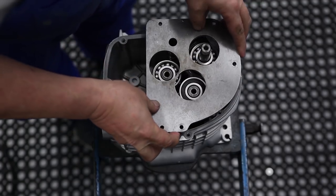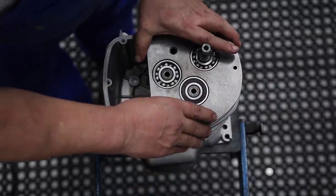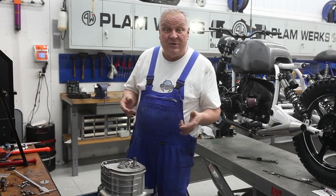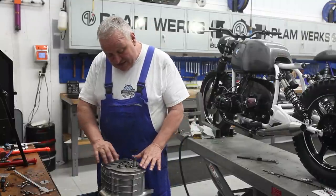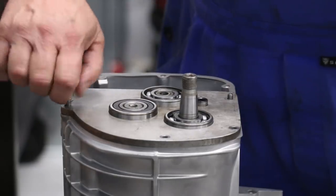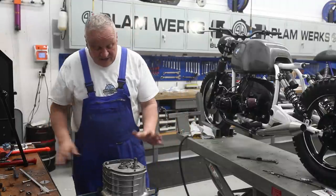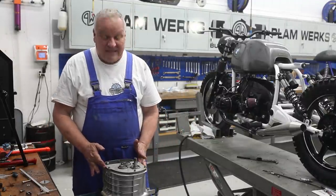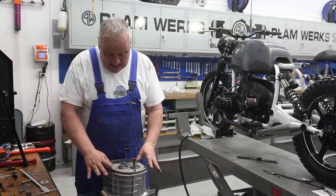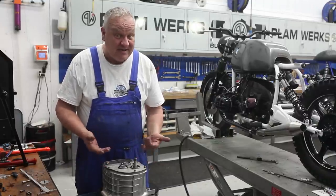And it fits on there. Now, I like to, some people don't, measure with the gasket. There's different ways you can do it with or without the gasket. The gasket is approximately 0.3 millimeters thick. I just measured it. So you could add that in later or just go ahead and put it in. Either way. Okay, so now I've got that special measuring plate installed, and the bolts are just snug. You don't want to go crazy, but if you're measuring it without a gasket, you have to make sure you add the thickness of the gasket when you do your calculations.